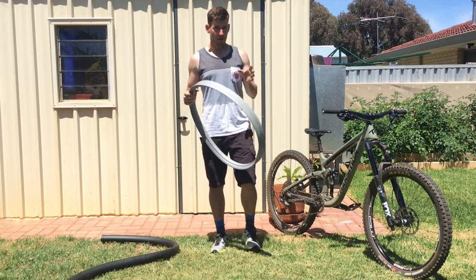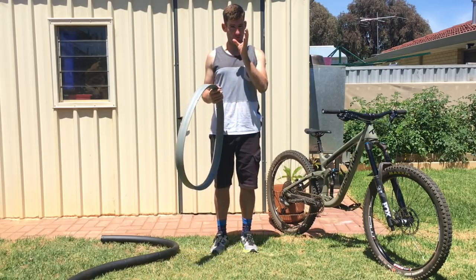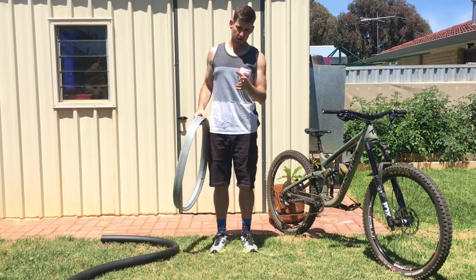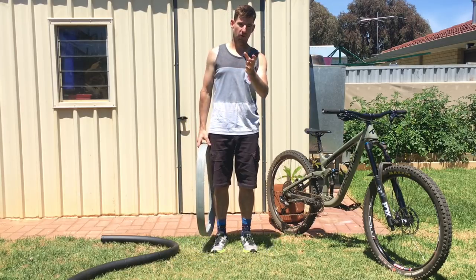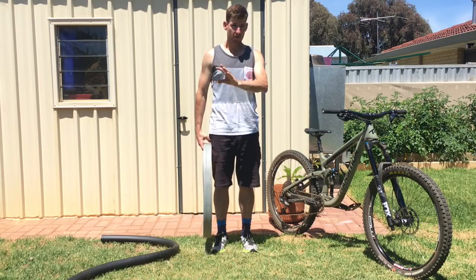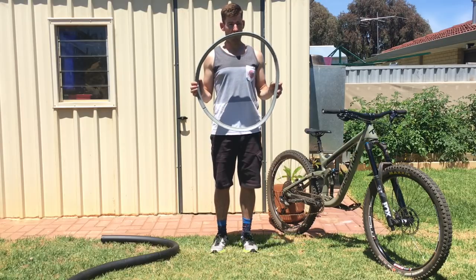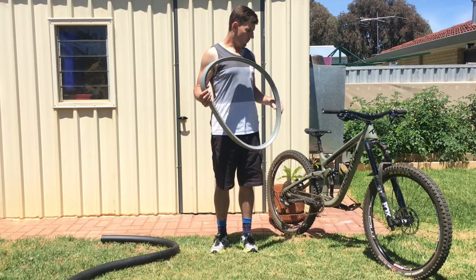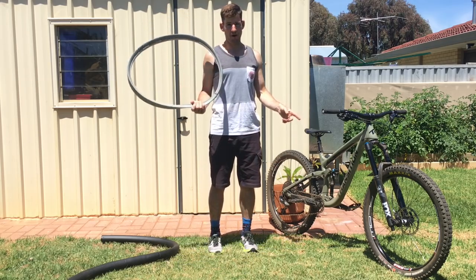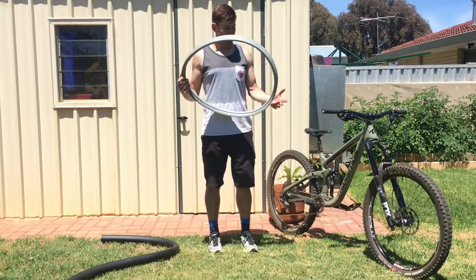But for that stable feeling that you get out of your tyres, which is why I run the pressures that I do, because my tyres feel stable, consistent, and nothing's going to move. Whereas when you're running the lower pressures and you're slamming corners, the bike will do a little bit of that wobble, and it completely puts me off. So I can run 1 or 2 psi less with the Cushcores, but I wouldn't run any less than that. So 26 in the rear, 24 to 25 in the front. That's without a Cushcore in the front and with a Cushcore in the rear.